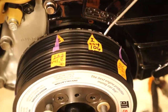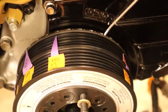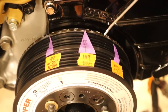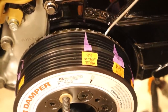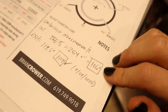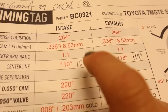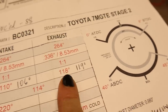I could have chosen 50, I could have chosen 70 — whatever. I just chose 30 because it was convenient. I chose 70 as the arbitrary number on my exhaust cam. All you want to do is make sure you're hitting that exact same number both forward and reverse, adding the two together, dividing. This will get you the true centerline you have currently on both cams at this moment, so you'll know how much adjusting you'll need to do to match the specs on the cam card. After all that, I got 106 degrees on the intake side, which is a little too advanced — they want 110. So I'm going to go ahead and retard the timing four degrees. On the exhaust, I'm leaving it as is — they want 118, I got 119. That's pretty perfect.